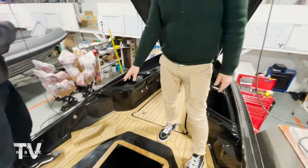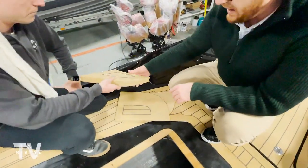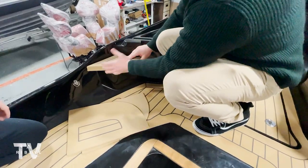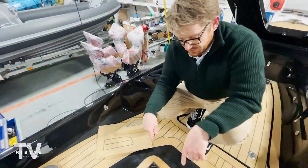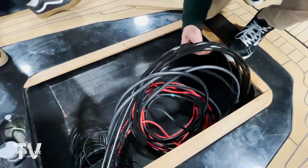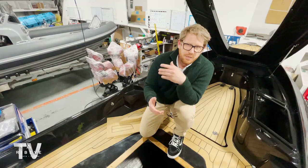You can see here some more of the teeth fit. A lot of the time you just get the teeth stuck on there, but what we do is we create this kind of bull nose system — so that will be shaped in there, all really nice and finished with a lovely overhang. The space below the console has loads of the main wiring systems going in — engine harnesses, and these are the hydraulic steering systems. On the Primes, when we run dual 200s, dual 300s, or 250s, we always go to proper full power steering systems, so incredible to drive.